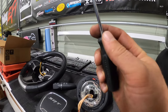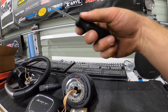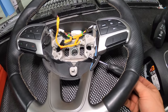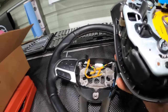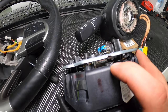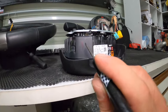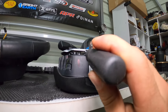Get yourself something that is pretty much the same size as the hole. Some people use an Allen key or something like that. I sacrificed a little Harbor Freight Pittsburgh screwdriver and chopped it off on the end so that I have a flat edge. Essentially what you're going to be doing is stick your screwdriver in through this hole — I'll show you guys where it pops through. You're going to come in at an angle and shoot upwards. That corresponds to a tab on the side. You're trying to get between the steel plate and the plastic to hit that tiny little bar. Using a modified screwdriver gives you much better odds of hitting it.